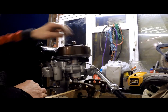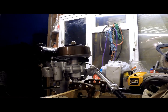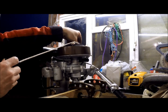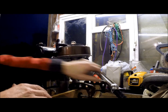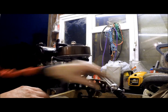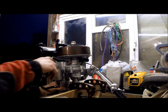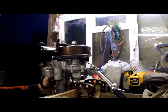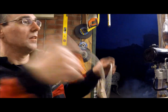So we're going to give it a bit of a try and see whether we can get it to start. I'm going to put our new cord in here, wrap it around, find the partial choke setting. Put the choke on — might take a few times just to get a bit of fuel into it. And let's give it a try. Sounds promising!